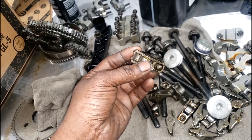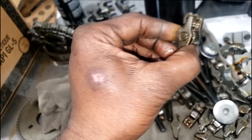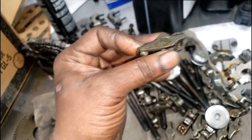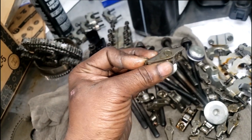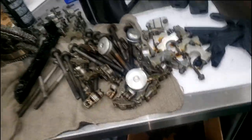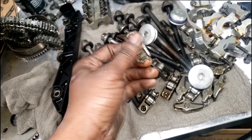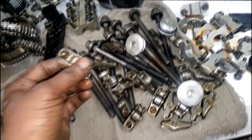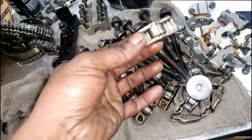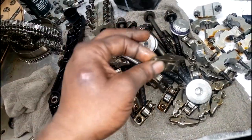I have never had to replace a rocker arm on a 2.7 liter V6 — all aluminum engine. The needle bearings in these had the same setup as the 3.6 Pentastar, but they held up. They held up well — I've never replaced one. Why couldn't the Pentastar hold up the same way? A better question is: why didn't they use the same vendors? I'm sure they may have saved a nickel or dime per unit, and guys, don't belittle that — it really adds up.